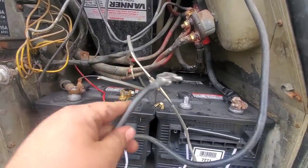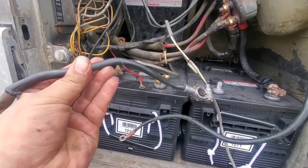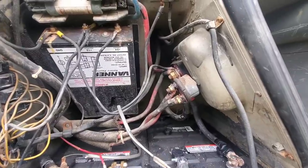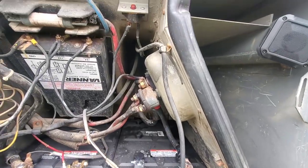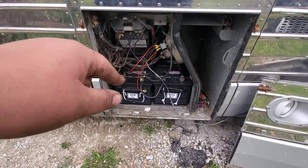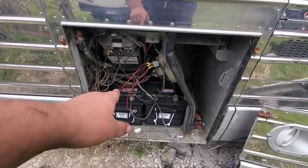This is the wire that used to connect the two batteries, and this is what we're going to replace it with. We're going with a bigger, heavier battery cable to make it flow a little bit better. Even if the old one is perfect, it's still resistance for the amount of power this thing draws when it starts. We'll get the new cable in here, then start mounting the switch, running the wire up, and making these two terminate up on that switch. I got the hole drilled — I'm definitely going to have a black eye though. Drill caught right at the last second and the battery smoked me in the right eye. Always remember to watch where you are around a drill because if it catches, it don't care. We got the wires hooked in there. I didn't have an inline fuse holder, so I just temped in a 10-gauge wire right there. I'll probably feed it with an 8-gauge or so with an inline fuse holder. I'm going to see if I can find some nicer crimp-on ends. I did have the heat shrink connectors for there though, so that was nice.